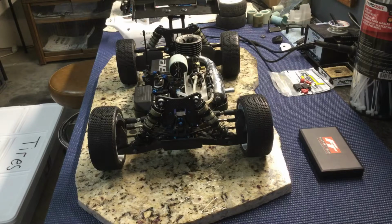I want to go a little lighter on the sway bar in the back. That's gonna help me out there, give me a little bit more roll. And so with that being said, the car is hooking up better. So now I'm ready to advance and more speed, hunting for speed, a little bit more power. And not that this engine don't have power, guys, not meaning that, meaning torque. Now I can put more power to the ground is what I'm trying to do now. Now that the car's hooking up better, I want to put more power to the ground.